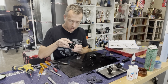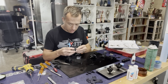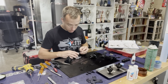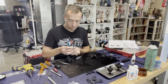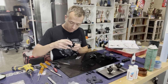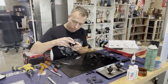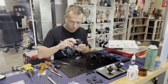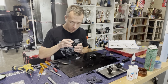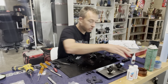I don't really like my backlash to be that tight. That's kind of car specific. Some cars, bulkheads aren't super sturdy. We'll get some flex. You need your backlash to be a little bit more critical. Our stuff, it's not, especially on a front. Definitely not gonna have any worry. So I'm gonna move it back to one shim on each side.